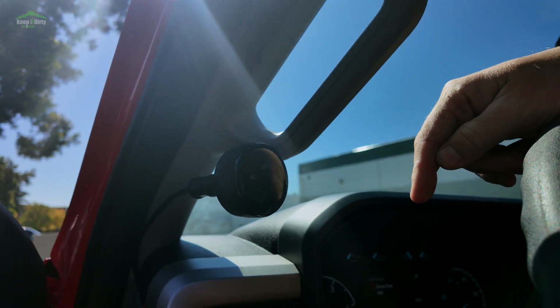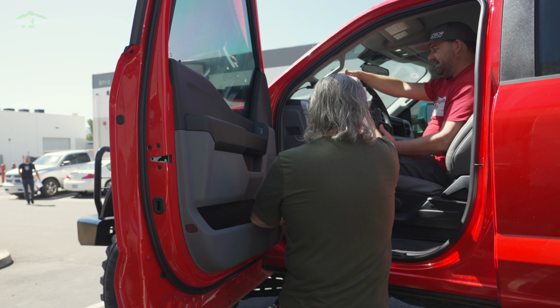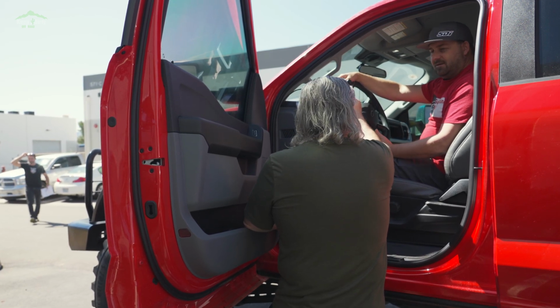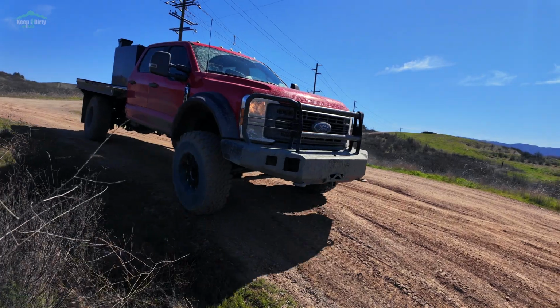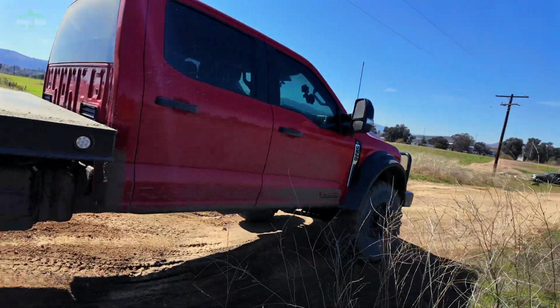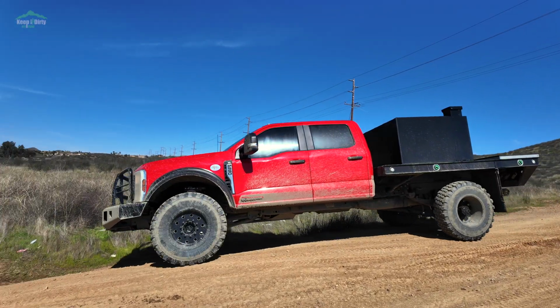Depending on what kind of roads there are, like when we're pushing in the whoops, we're definitely going to be hitting up desert. Street's going to be the most common, but if you get in a rocky trail, like I always like to use Mammoth fire roads because they're just all solid rock, you're going to want to go down to that rock crawling mode. So, your 15, 20 mile an hour type roads. It's a lot less about driver input and a lot more just about vehicle attitude. If you're rolling down a hill and your front end is low, it's going to stiffen those front shocks. But if you crank the wheel, it's not going to really do much because you're going so slow anyway.